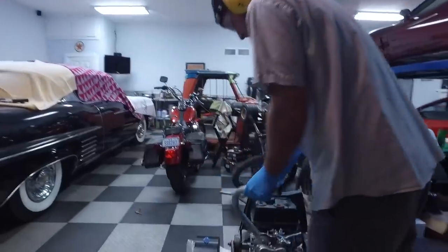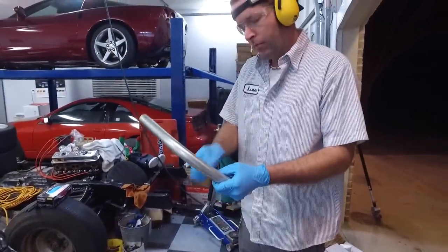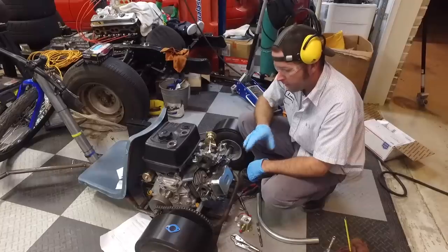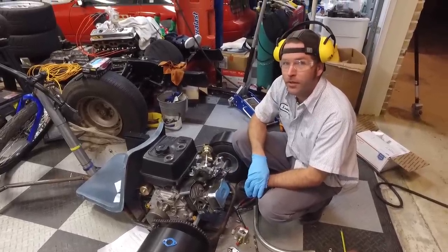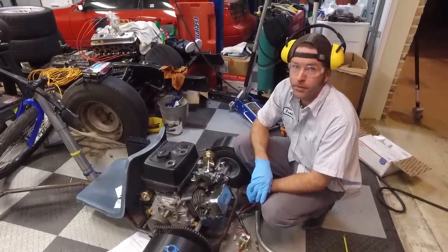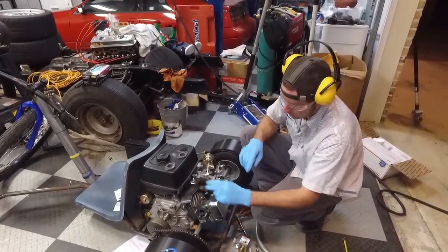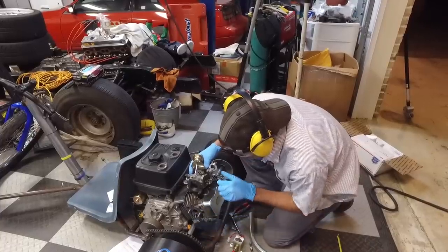It's gonna need to be a lot sharper than that. Well, what I was gonna do is a little pie cut. Pie cut, yeah. That's what I was thinking. Probably do a couple of pie cuts just to get a little bit sharper. The first flange we put on and actually get welded up will hold the turbo in place for the rest of them. So I think we ought to do this exhaust one first, which was gonna come around.